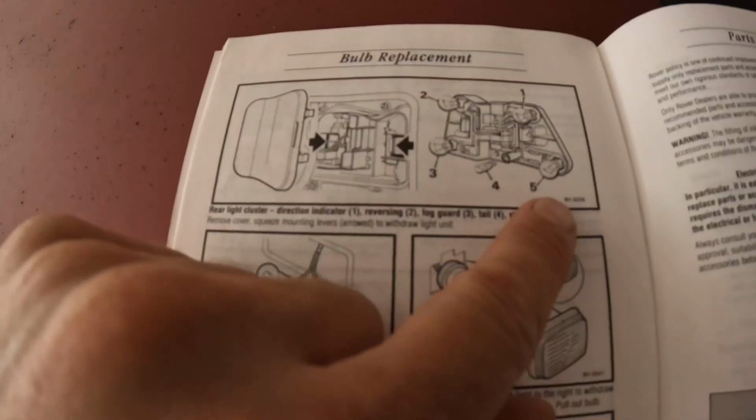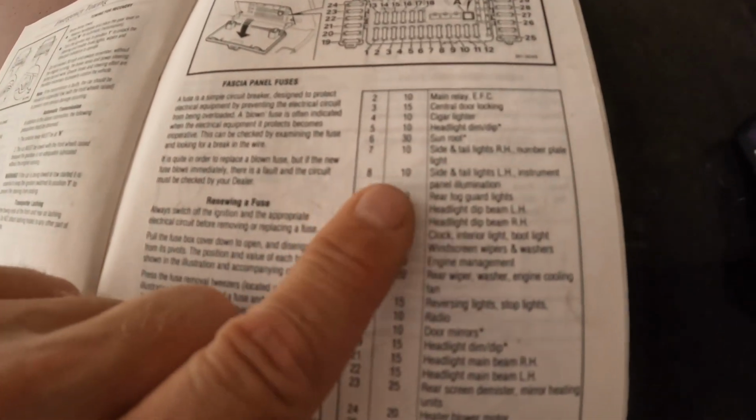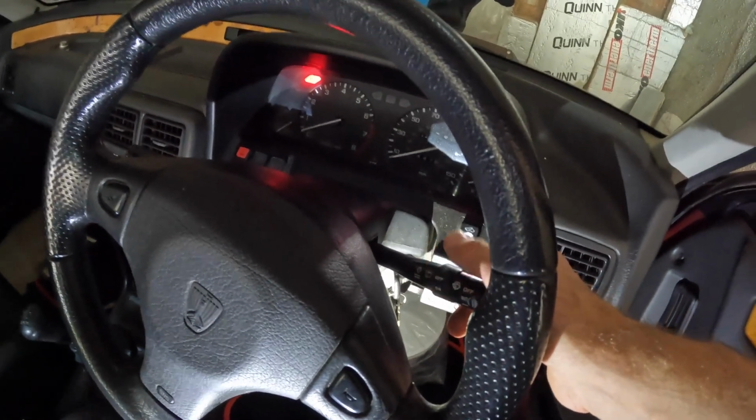So now to troubleshoot these lights, I'm going to go through the obvious stuff, the fuses and the bulbs, check out which one is what and what goes where. But also, the last owner did tell me that the lights had failed previously around the same time as the wiper had gone, so I'm wondering if perhaps there may be an issue with the wiring loom into the tailgate.